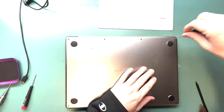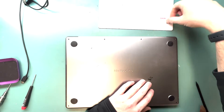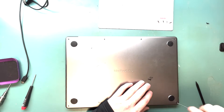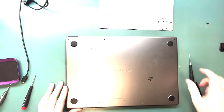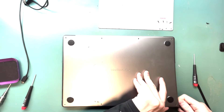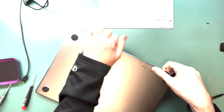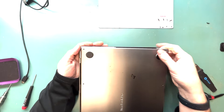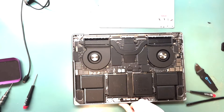Grab out that 4PL screwdriver and remove the eight screws from the bottom — you can also use a P5 screwdriver if you don't have a 4PL. Once all the screws are out, grab your metal pry tool, start from the bottom, get under the edge and lift it up — you'll feel it pop. Then grab it and slide it downwards towards the longer side, and boom — bottom case is off.